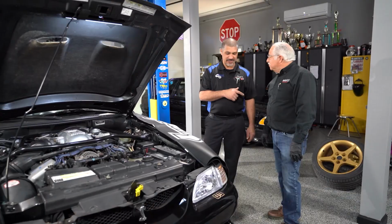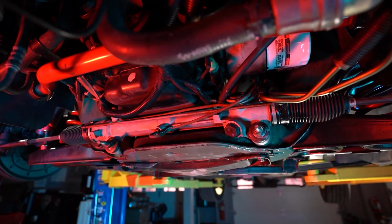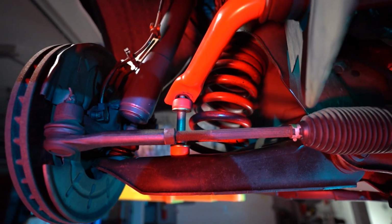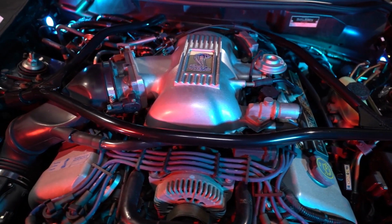It's amazing what a difference the front shocks are from a Saleen, from an OEM to a Saleen. Saleen was a road racer, so all of these things were really built to run well on the road. So all those changes, the difference in the springs, the shocks, the bars, all of the changes they made in the car, that's what made these cars handle and as much fun to drive as they were.